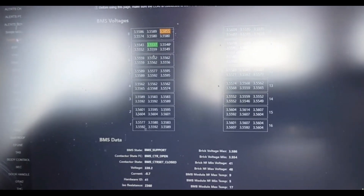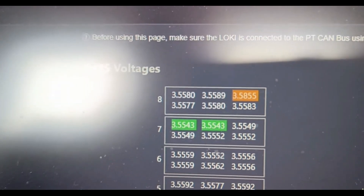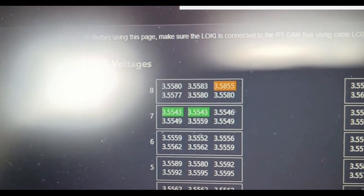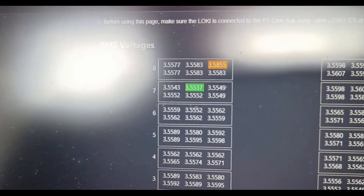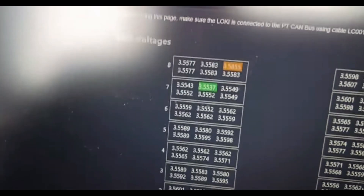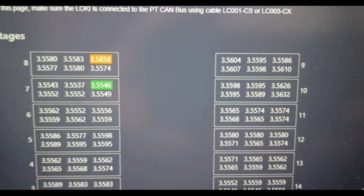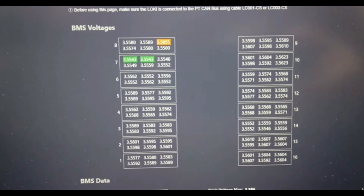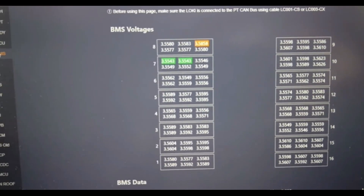We started collecting the battery, but then a little embarrassment: Tesla got in touch with its server and the server flagged a problem with the battery. The error popped up again. The cell voltage runup at that moment was 30 millivolts. We planned to balance each module anyway, and it was decided to do a full balancing of all modules in order to reach an almost perfect balance.